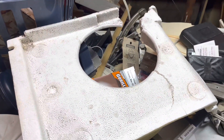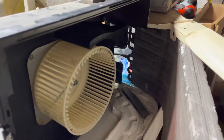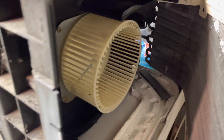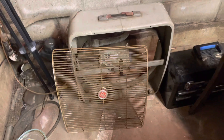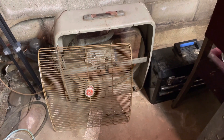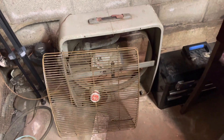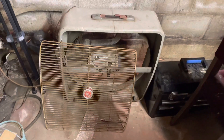Okay, so I cleaned this thing off with a sponge and some soap and water — this is the next day. I got the blower wheel back on and took the evaporator off as far as it would go. I'm about to put that piece of foam that's all broken back in. I'm not having a good day so far, because I broke that last night. And I was trying to clean out the motor on this 50s GE box fan and I dropped the motor and broke a winding, so now that motor is for donor parts only. Which is kind of convenient since I needed a felt washer for this one anyway — I'll just take the one from that and put it in here. That way I don't have to buy a new one.